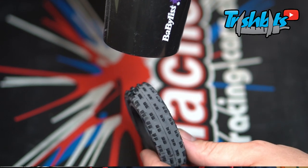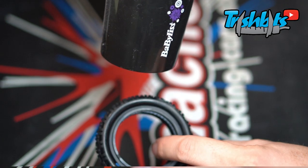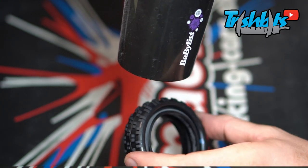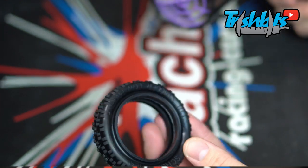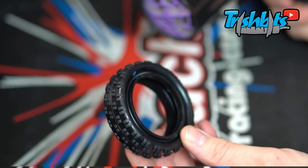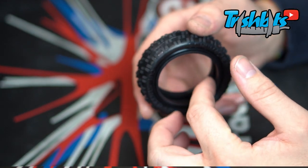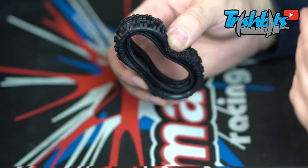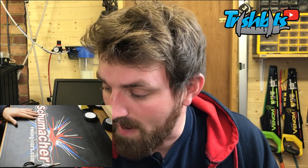When tires come in and they're grey, get a heat gun or hair dryer on them. Give it a blast and it will change from grey to black — it won't take long and it will take it back to the original state. When it's gone grey it's oxidized. Some tires come into bloom, go a little white, and react to oxygen. Even if you glue them when grey they'll still work great — it will brush off and you'll be back to the true nature of the rubber.